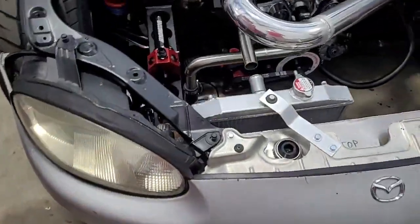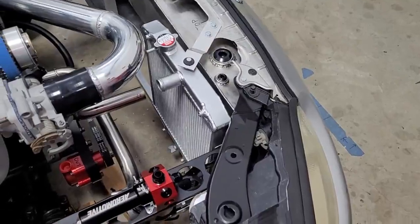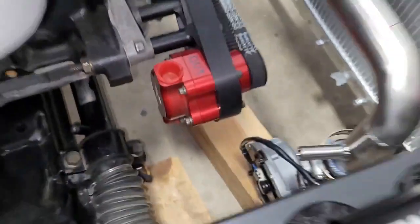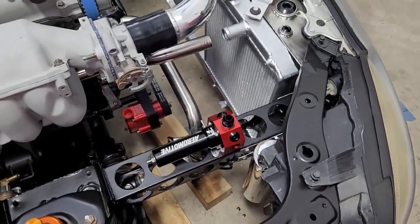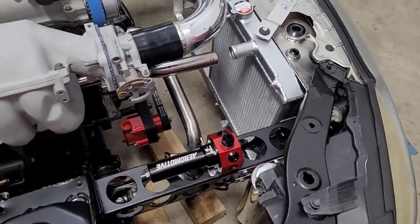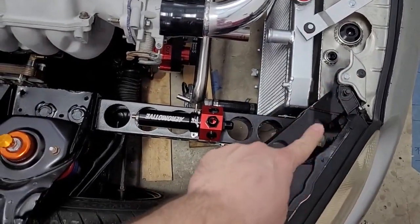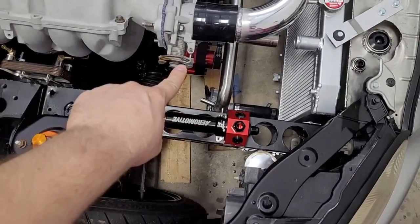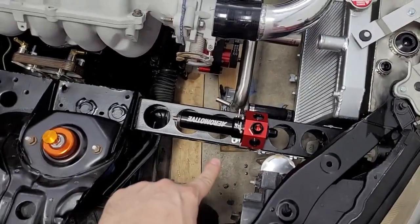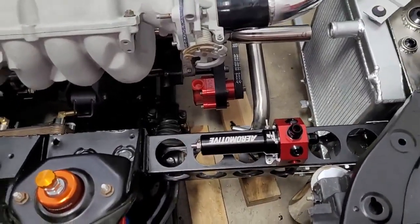Here's the thing. For the fuel system, we've got our fuel cell up front. There's a 12 AN coming out of the bottom of the tank, and it's got to get over to the inlet of the pump. Inlet's on the bottom, but we need that 100 micron fuel filter in line between the tank and the pump. That way no big chunks of debris get into our pump. That would be bad. So what I think we're going to do, if we look at this aerially, is this hose is going to come out of the tank and loop around. We'll probably use 2 hoses, and we'll just put the fuel filter in line. Then there'll be a second hose that reaches over to the inlet of the pump. There's actually some room down there, so I don't see that being a big deal.